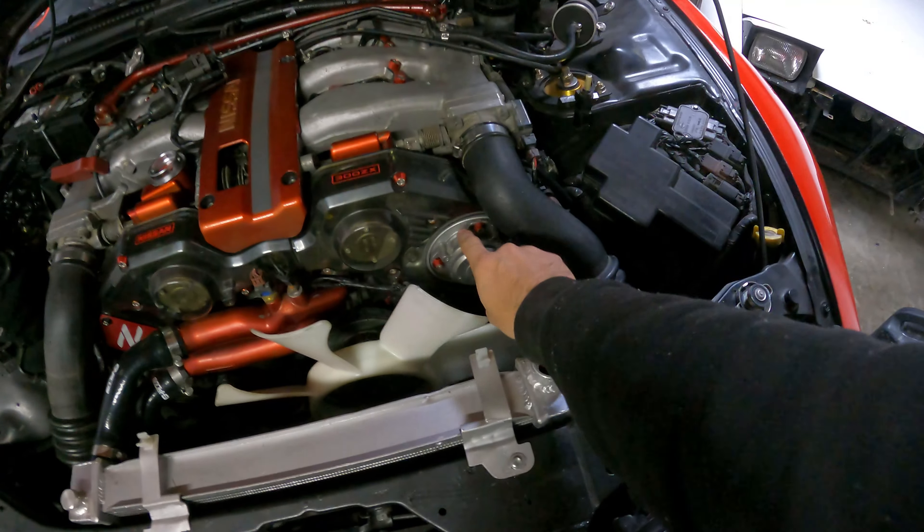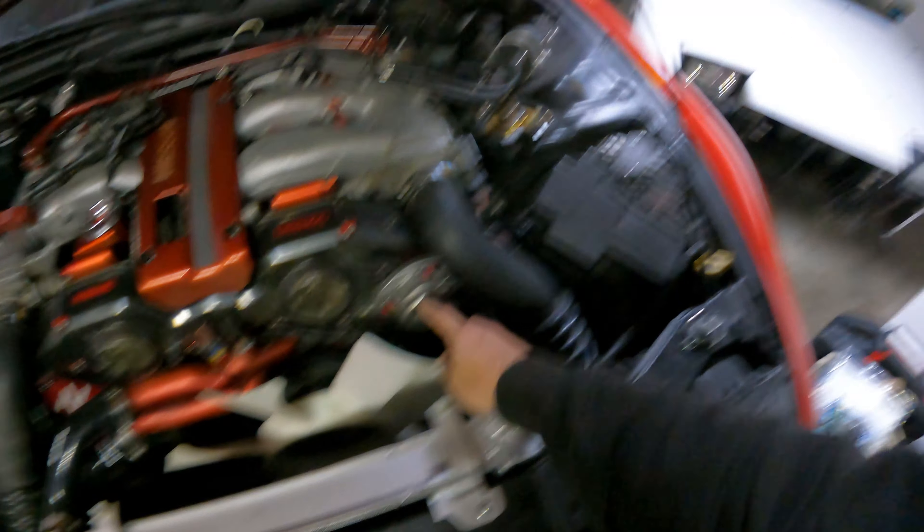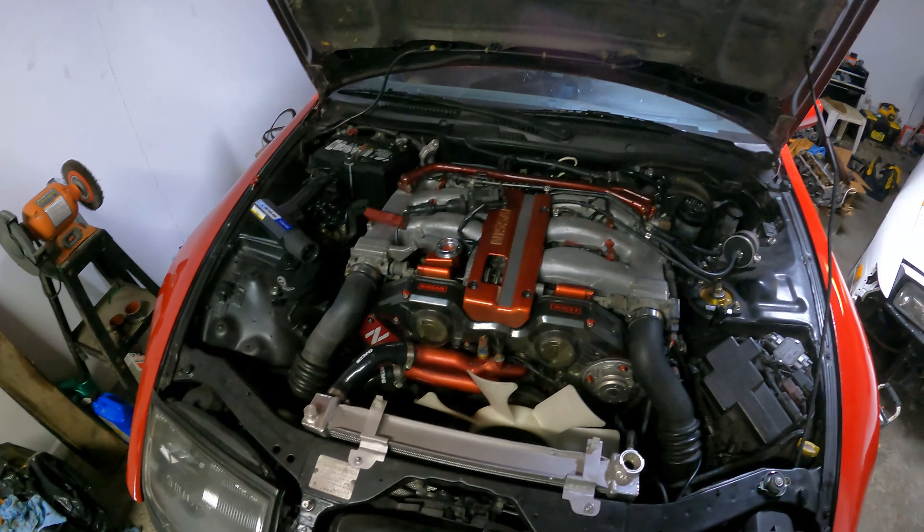Especially for a timing kit — because you take off the crank seal over here, you have to remove the crank angle sensor when you do that. Essentially you're throwing it out of time, and when you do a new timing belt you need to retime it anyway. You can't always just mark it and put it in the same spot. Enough of the talk, let's get started.